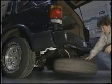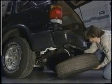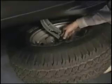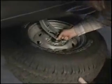The tire would gently lower, ready to swing into position partially under the bumper, thereby allowing easier removal. When finished, the tire is returned to the carrier and manually rotated to a position under the bumper. Then by taking the tire iron, the spare tire system can be manually returned to its stored and locked position.